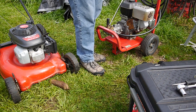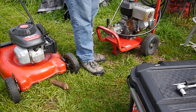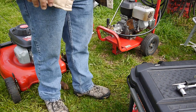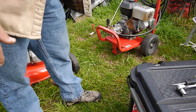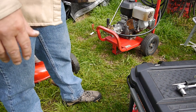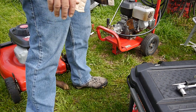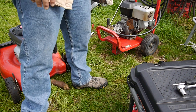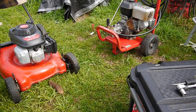It's a Briggs & Stratton, kind of light duty — five and a half horsepower, 2200 PSI. I have others that are 3200 and such, but this one's doing the same thing. I actually used this and power washed everything around here and it started to look good, but it was pulsing. I was having to turn the choke a little on to get it to stop, and then it would flood out. Let me see if I can duplicate this.